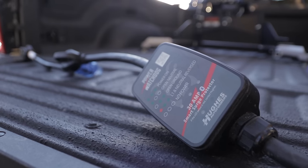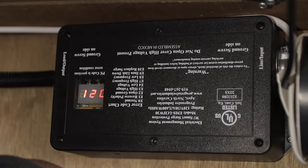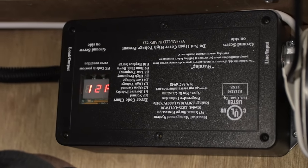For our setup, we have a portable surge protector we can test before we even pull into the site, giving us that first layer of surge protection. We also have a hardwired EMS device inside the RV — out of sight, out of mind, can't be stolen — and it actively looks for any problems and will shut off power before that problem reaches our RV. It's definitely overkill and redundant, but I recommend getting an EMS device for your RV to protect it.